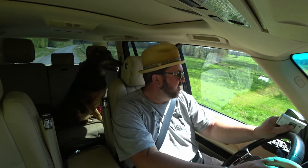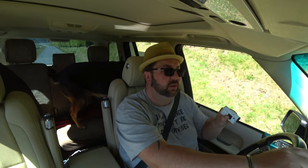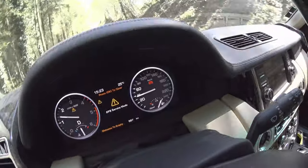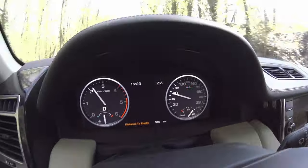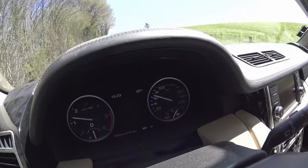So there we go — 10 times. Now we've done that 10 times, what you could do is just switch your ignition off and that ignition cycle will reset the service mode, or you could just get it up to speed and it should just switch off. We'll just get round these roads and I'll put my foot down and it should reset and come back out of service mode. This car's in kilometres an hour so I've got to get it over 50 kilometres an hour — and there it is. So it's gone off now — went over 50 kilometres an hour and it's all off.